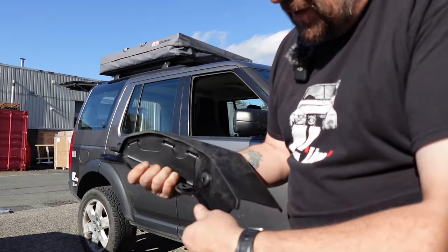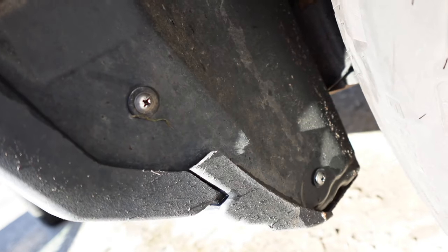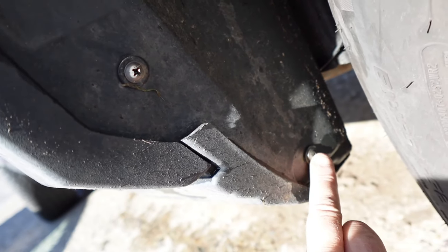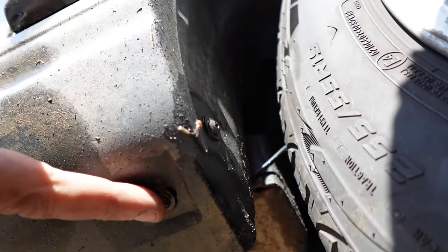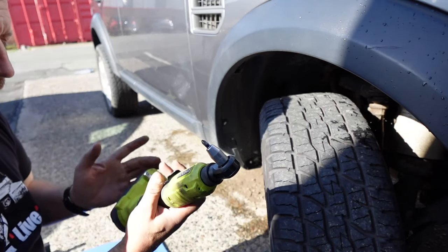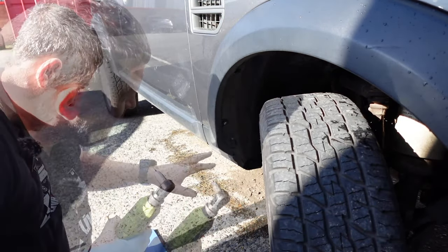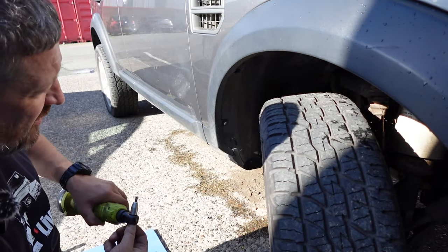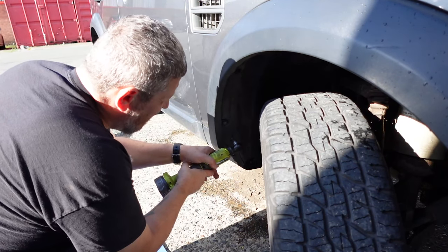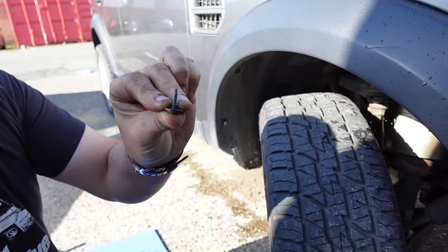The quality is really good — it's an aftermarket part but it uses the Land Rover design right down to the small details of the edge moulding. On the front right wheel arch there's one screw down here, one screw up here, and one underneath — all three need to come out. I'm using our cordless ratchet driver again — it's a Ryobi tool, not a sponsor, picked it up from Halfords for £150 with charger, battery, and unit on offer. Don't go in with this if you're worried about rotten screws, but you can get a gentle start on them.